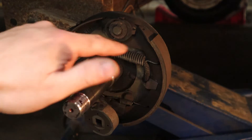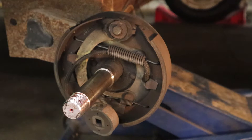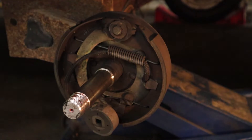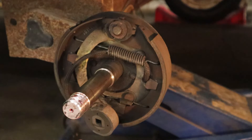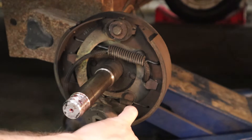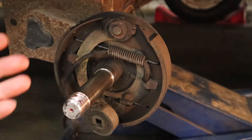This brake system is electric using a drum brake style — we have two brake shoes here with a lining that wears out. For my reference I want at least one millimeter from the backing plate out on the friction material, or about 1/16th of an inch. Anything less than that, they're due for a change. Note which is the skinniest spot. If measurements are different from the other side, you may need to adjust the star wheel adjuster, lube it up, and set both sides evenly — otherwise one brake may grab harder and cause the trailer to pull.